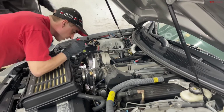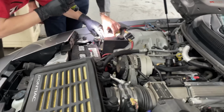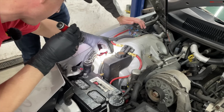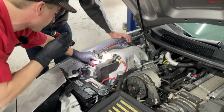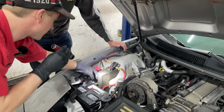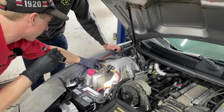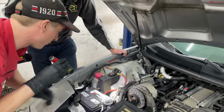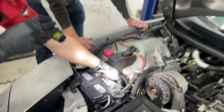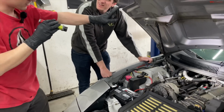Now, Toby, do you think a lot of this has been aftermarket over here, like these electrical connections? Some of these are going to be factory, actually, basically a junction point they have on a lot of these cars. The reason they did these junction points is the jump start is really hard to get to sometimes, because the power steering reservoir here is kind of close to the negative, so they put an extra positive jump start point and usually ground somewhere else. Oh, gotcha. Someone actually put a nice side post, top post in this one. So you got side posts that hook up to your battery, but you also got top posts, which are a lot easier to jump start a car with. That's pretty cool. As long as they don't hit the hood, you're good to go.